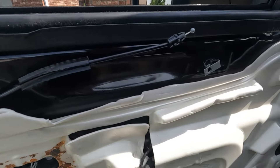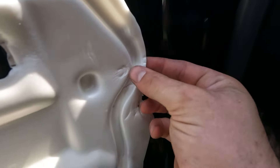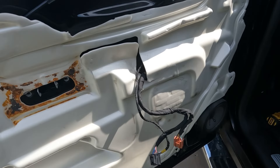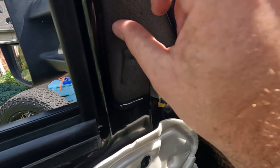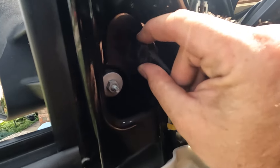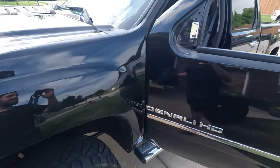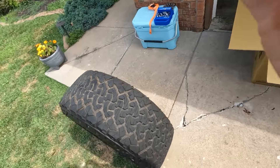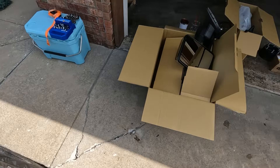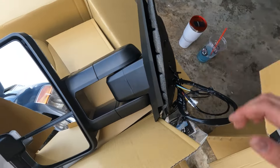Door panels are a very love-hate relationship for me — mostly hate. But got that off. We're going to check out this insulation here, which looks like somebody attached it with hot glue or something. Take out the little foam piece, and we've got our nuts for our mirror. We're going to peel this back because we need to get to that mirror harness. And just like that, we've got the mirror removed from the truck. Still a good set of mirrors — somebody could definitely use these, I'll probably sell those off.